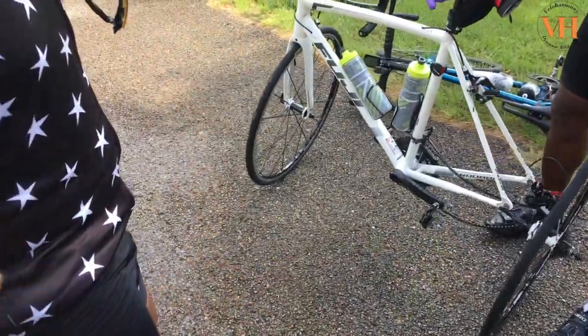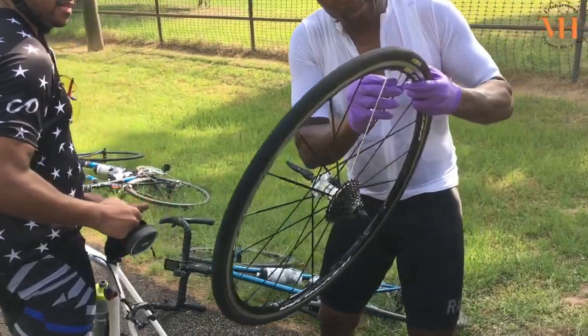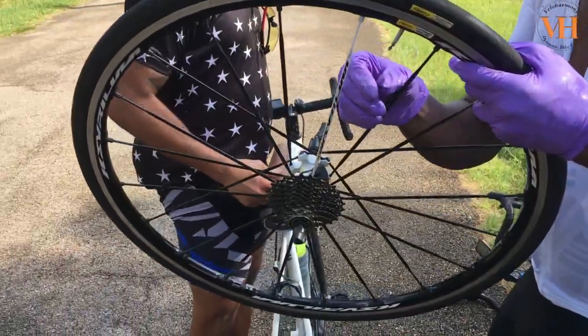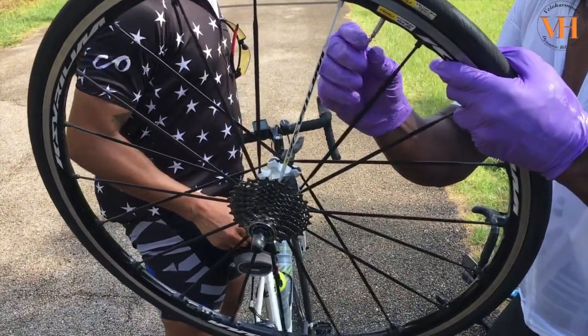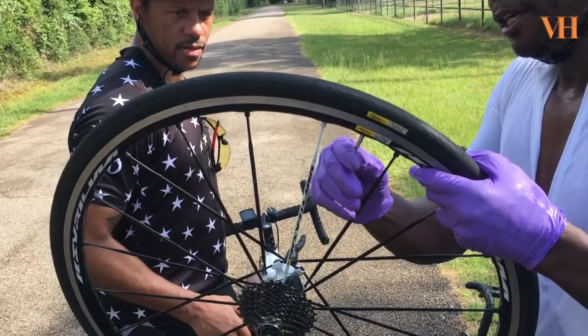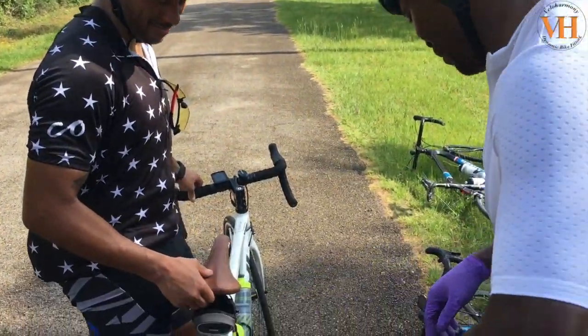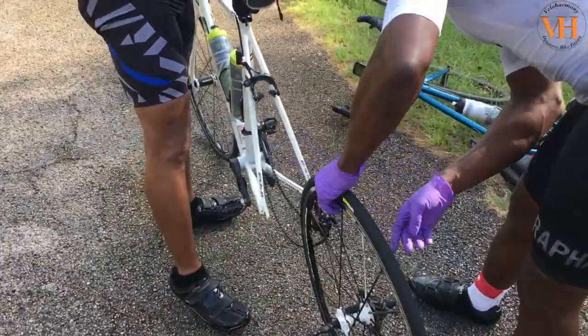Let me straighten that thing. Hold your bike — let me straighten the valve. The valve head's a little bent. So what I'm going to do is straighten it. The small pump bent it when I was using it. I'll straighten it a little bit — you don't want to get too crazy, but there we go. That's good. That's why you don't need the black cap on a Presta valve — if dust gets in there, it wants to be in there.